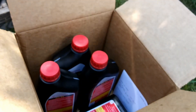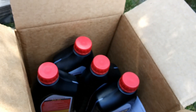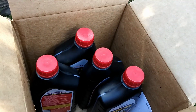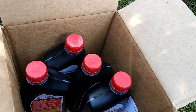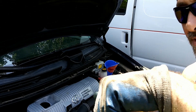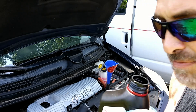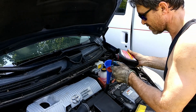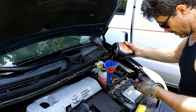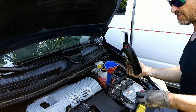This isn't going to take all four quarts, but we'll put three in there first and then start checking it by pulling the hose out a little bit and reaching down to feel for the fluid. I'm not recommending you stick your finger in that hole — you can make a little tool out of something clean to reach down and check. If you're in doubt about the smell of the old fluid, take the top off the new bottle and get an idea before you pour it in. You can also see the difference in color — the stuff that came out was quite a bit darker.